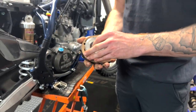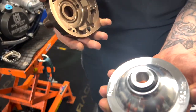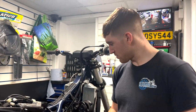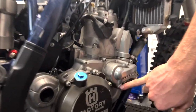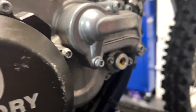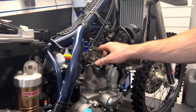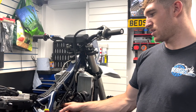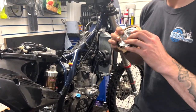Looking very nice. Slot that back in there. Always ensure the O-ring is on there, otherwise you're gonna have a leaky spark plug. So what we've got to do, drain the coolant out of here. Dan will show example A in just a second. Top coolant hose off. Unplug temperature sensor, undo temperature sensor, spark plug, job's a good one. Bang on, new gaskets. Let's go.